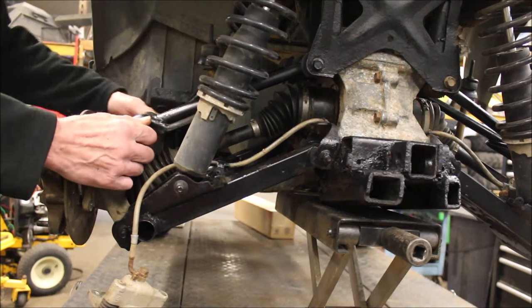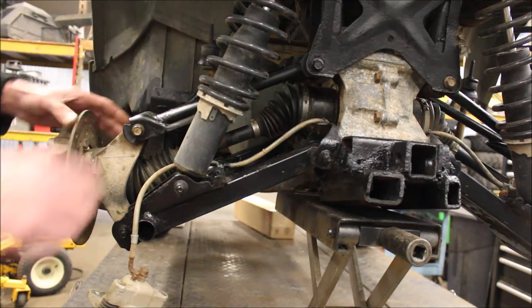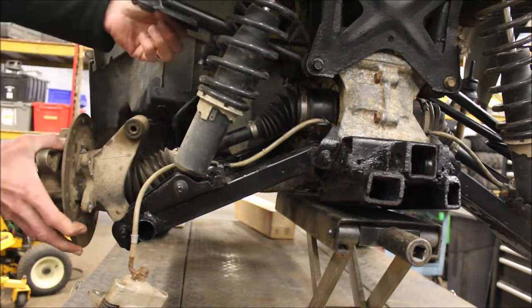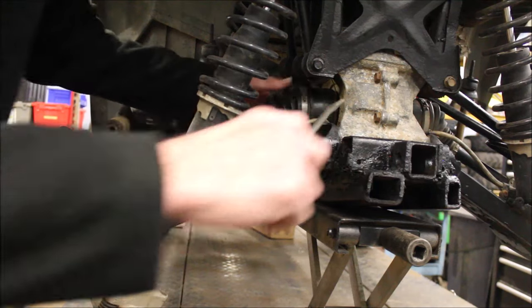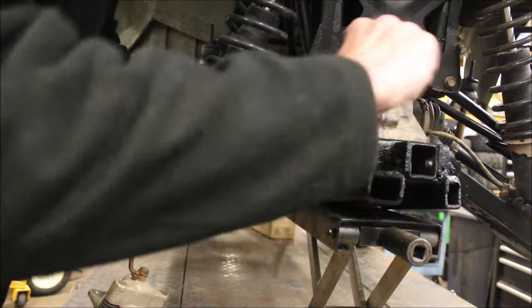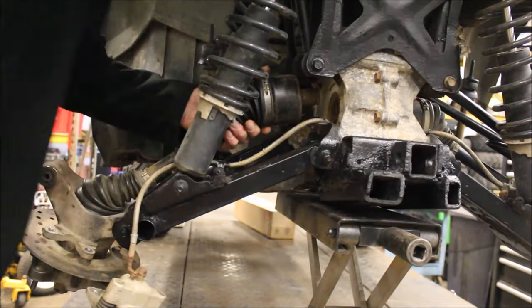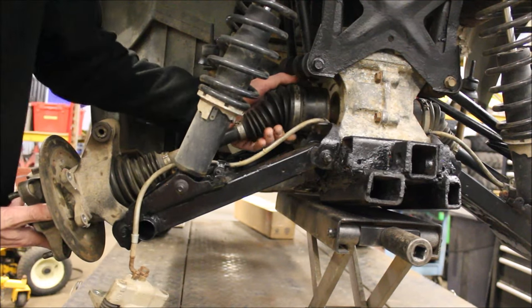So, I got this loose already. I'm only gonna show you guys what I found out. Pull that up. If you gotta remove your axle shafts, a lot of times I use a screwdriver. Just came right out. Now watch what happens when I put it in slightly.